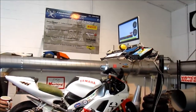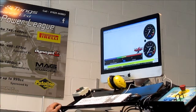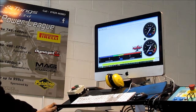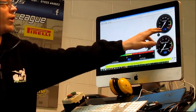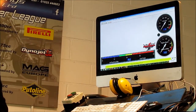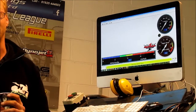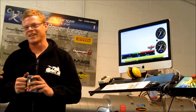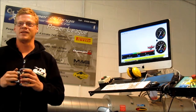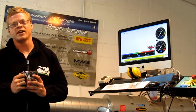If I just turn the camera up to the screen and the computer, there are some nice clever dials and things. What we're looking at here is an air/fuel reading — we've got nothing at the moment because the bike's not switched on. We've got an engine speed which relates to the pickup. We've got braking so we can apply a braking force to the dyno if we want, which can simulate actually riding on the road. At the moment there's very little load on the drum, so it's actually much easier on the bike riding here on the drum rather than riding on the road against wind resistance. That's a nice little dyno myth busted — your tyre won't destroy itself.